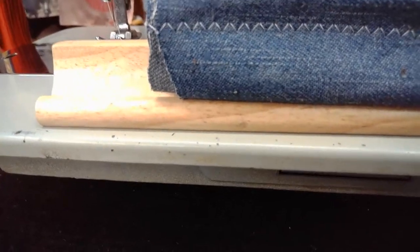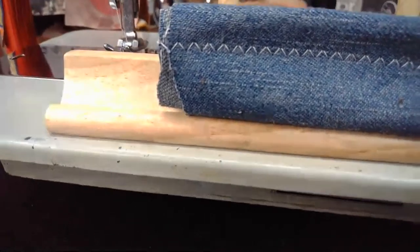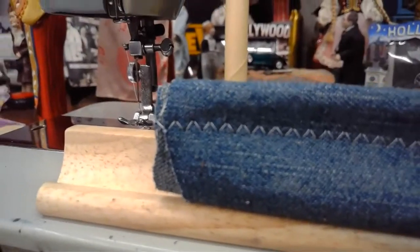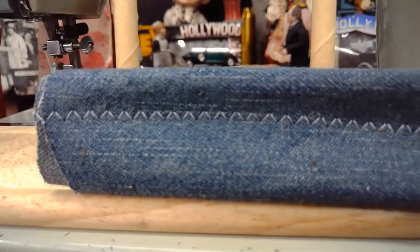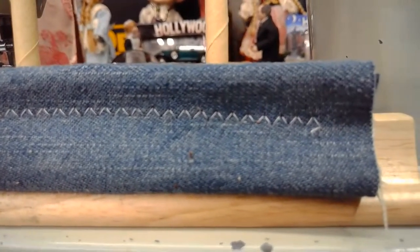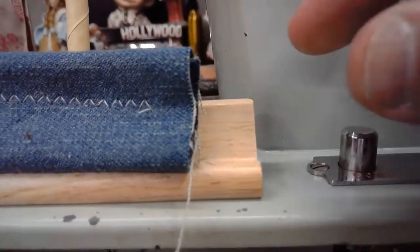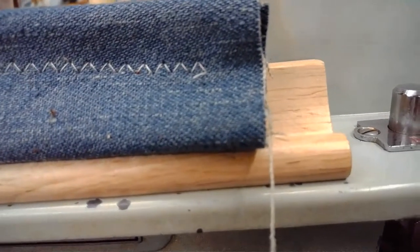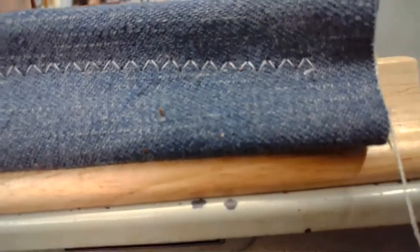All right. So again, we did close to a 3x3 zigzag. So we weren't at full range. There we go. Beautiful stitching, beautiful stitching. And I don't know if I have the ideal angle of this, but it gives you an idea. And again, we're talking about six layers of heavy grade denim, so it's not a super light sew-off either. It definitely is not a light sew-off.